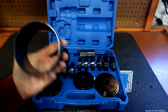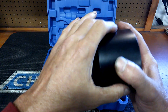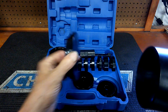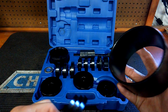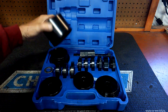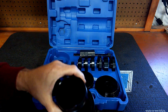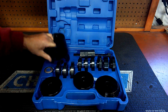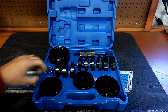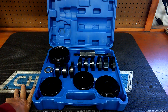You go on the back side of the knuckle and put this piece there, then put the other adapter on the front side and push the bearing through — the bearing falls into this cup. There are all different sizes, about five sizes with steps in them too, as you can see. Very nice set for the money. The dies are pretty heavy-duty and there are enough to fit just about any wheel bearing I've come across.